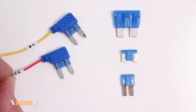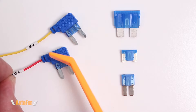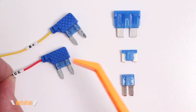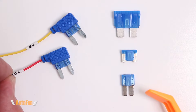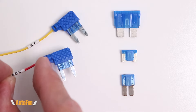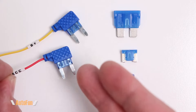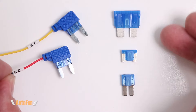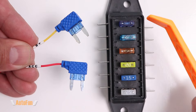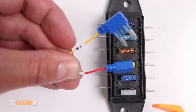However, there are some disadvantages to having these molded-on mini fuses. The first is that if my vehicle does not use the same fuse size, these are not going to work and I'll have to cut this off and install the correct fuse size in order to connect it to my vehicle. The second disadvantage is that if I don't have an empty spot on my fuse box, I'm not going to be able to connect them to it.